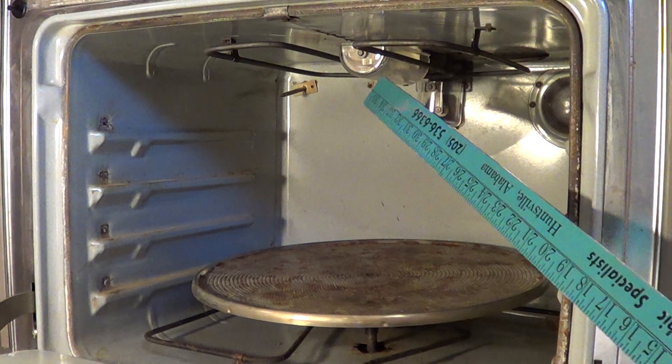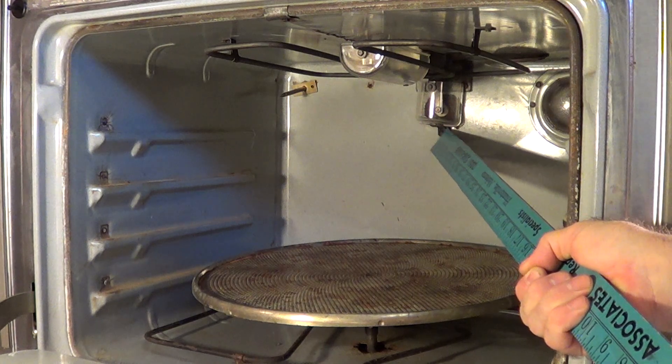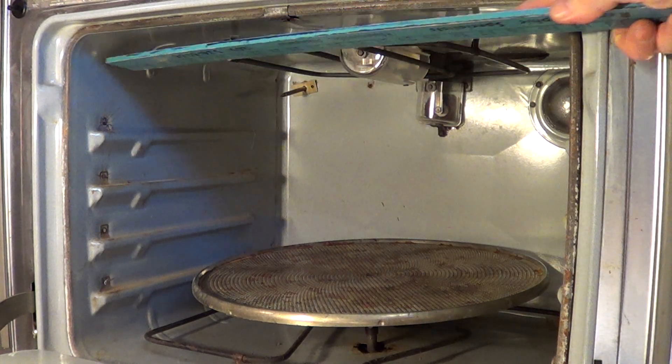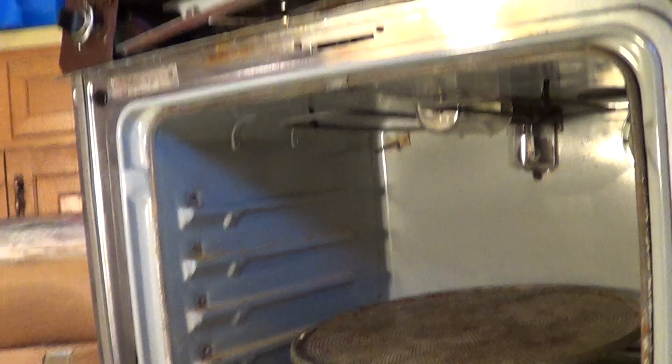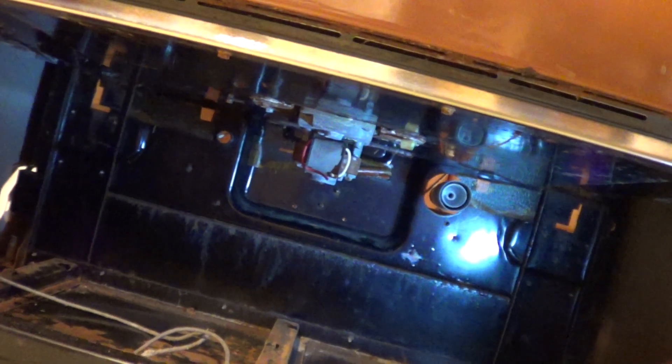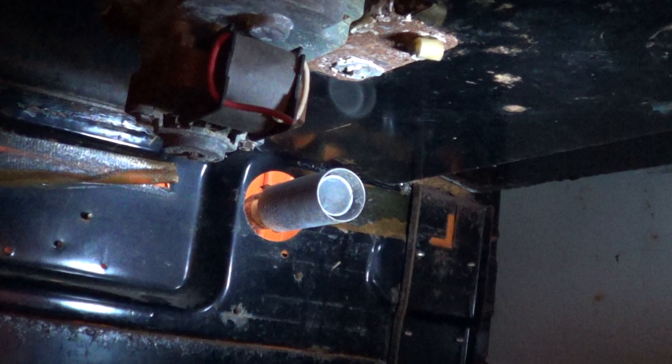Here's the 915 megahertz antenna — an early microwave. It's fed in the back by the waveguide. This particular oven went underwater in Katrina, all the way up to the top, so the microwave portion has been taken out. This is a Hotpoint RHV 886. There's a sister model called a General Electric J 896. In the bottom here, the waveguide is in a regular Americana type oven. The bottom portion is a storage compartment for pots and pans, but the big microwave portion went up underneath here. That's the feed — the part from the magnetron shown in another video by Mr. Rudy Deal.